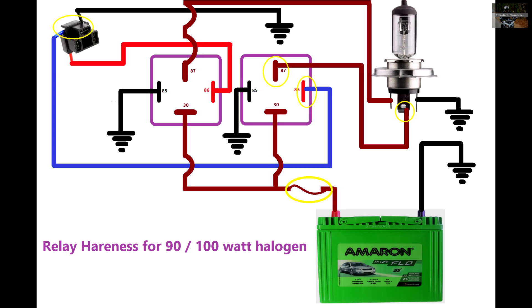Getting on to the working of the circuit: let's look at the low beam part. When the low beam of your vehicle is on, the yellow circles show where power is flowing — through the low beam connection from the H4 socket, actuating the appropriate relay. Then for high beam, power flows from the H4 high beam pin, actuating the other relay, which supplies the headlamp bulb. For high beam there is one dedicated relay and connection; for low beam there is another relay and connection. When designing your harness, make sure they are bundled well, properly taped, with proper sleeving and good-quality pins.